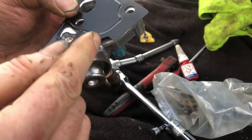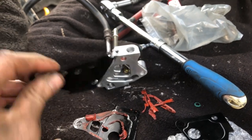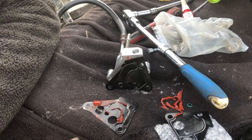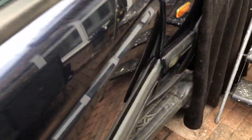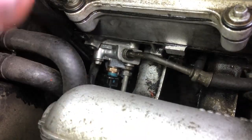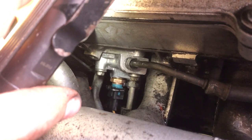Just check you've got the right gasket - if it looks like that, use the correct one. I've also read on forum posts that people have had these fitted by third parties and still had the leak. The fuel system has been bled following the procedure shown. It's all back in and there are no leaks whatsoever. When we bled the fuel system it took three or four bleed sequences and the engine management light was flashing - just let it do that, it'll stop. No leaks. Job done.